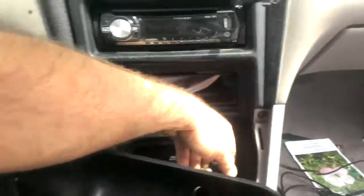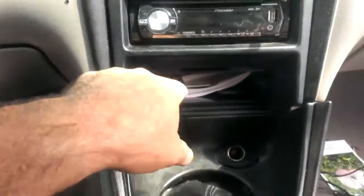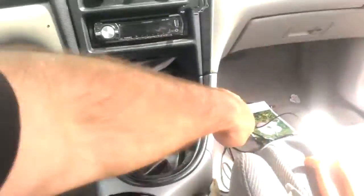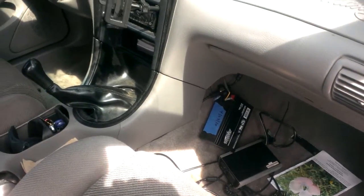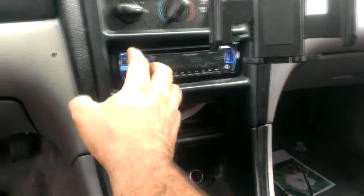I'll have the main battery disconnected to be safe while working on the car. The diode-capacitor part of the circuit will hold the radio when I just want to disconnect the battery long enough to clear the computer. And then I can connect the external battery to back up that memory for longer repairs — like what I'm doing right now, changing the radiator. That 12-volt battery will definitely keep the memory. It's been a good hour or so, I've had the battery disconnected with my little battery down there. I've just disconnected it and tucked the wires back. Yeah, it retained the memory.